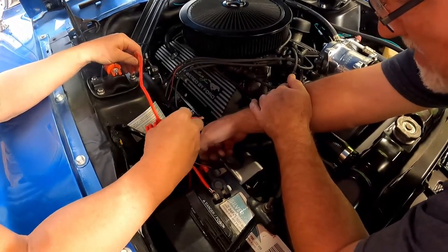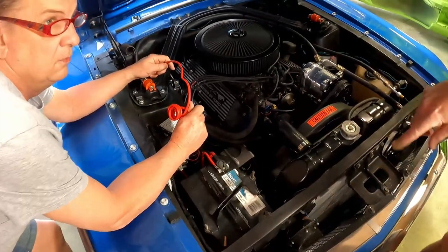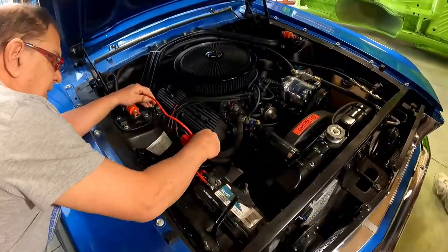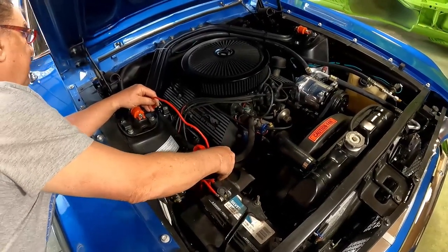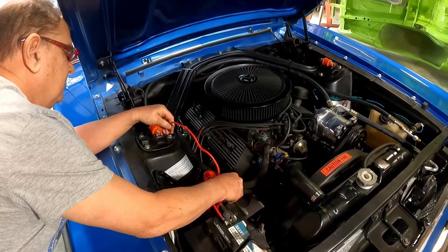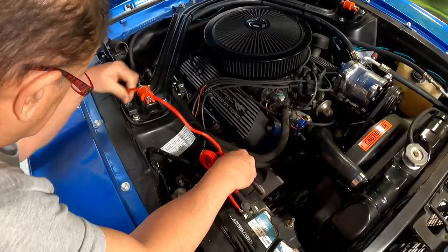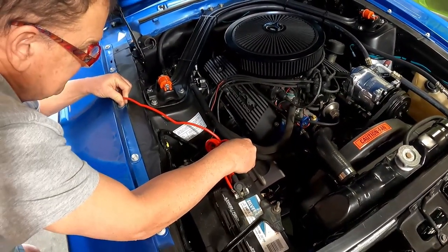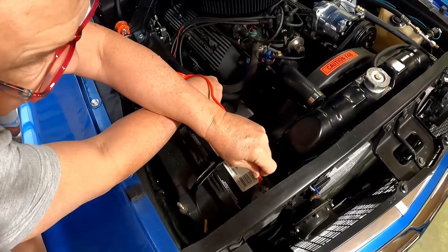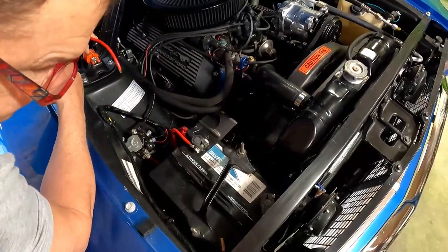So just take that. Your lights wouldn't come on. True. The interior lights, when you had it grounded, I noticed they clicked on. Okay, open your door. Let me see if I just touch this to ground. They should come on. Okay, now. Nothing? Nothing. Now? No. Okay. How about go back to the battery. We got lights. Okay, yeah, it's got to go back to your battery.